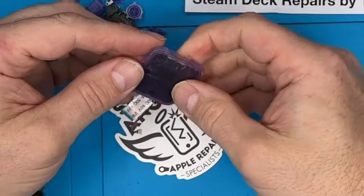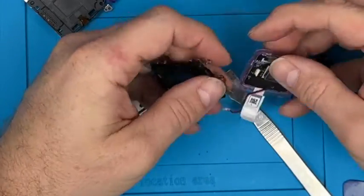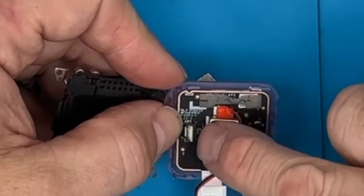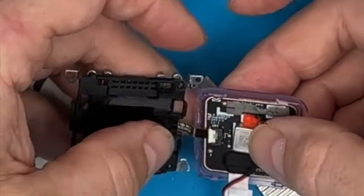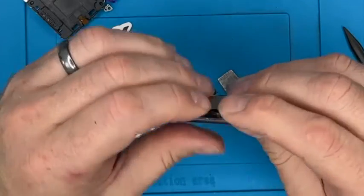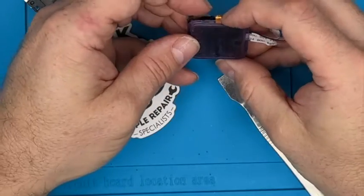Okay, so we've got that far, and we'll reuse this. So we flick the clasp up, we lay the cable like so in. You see that little white line on the cable, you'll find this on many. That line lines up with the back of this clasp, so then you know it's all the way in and it's in square. We literally just push the clasp down really gently and it grasps the cable. Then we flip it over and reclip it in, which is darn sight easier than before. 1, 2, 3, 4, 5, 6, 7, and 8. There we go. I think over time that'll warm up and probably re-adhere itself, but yeah, interesting.